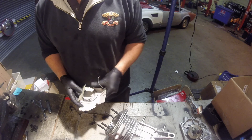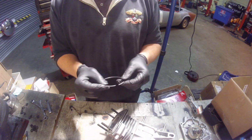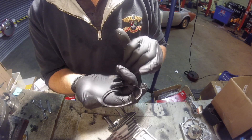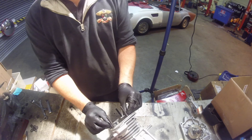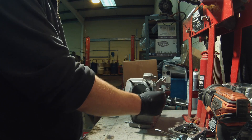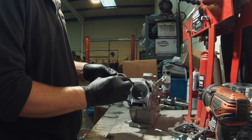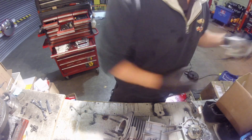We tend to fit just a standard oil scraper ring and only fit oversized top and middle rings. Make sure — you probably won't see this in the camera — there's a tiny little marking on this side that should face up. We want to place the ring in the bore; obviously these aren't going to fit because they're oversized, so we need to file them down slowly until the end gap is just right to fit in the bore.